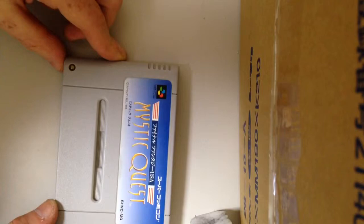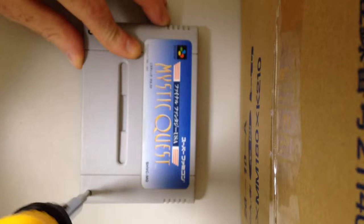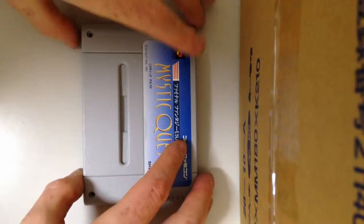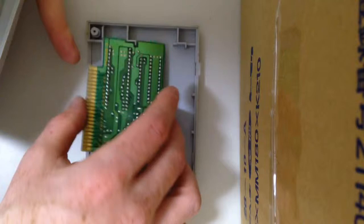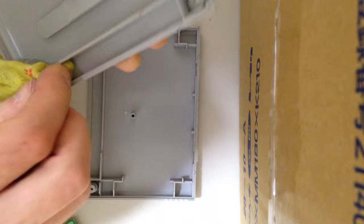So that's the outside done. If you just get your game bit — so 3.8mm game bit — open this up. Always clean inside here and inside the bottom there. That's important because anything that's in here could eventually end up in your Super Famicom or your Super Nintendo and gradually cause games not to work and cause damage to the system. Because it will eventually just stop working, it's so grimy. The contacts in your Super Nintendo or Super Famicom — you're basically importing grime into your console, which is never a good thing.